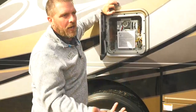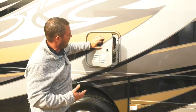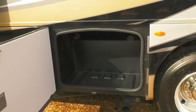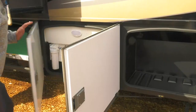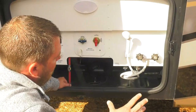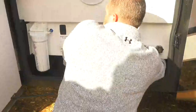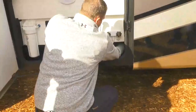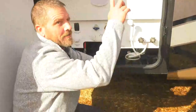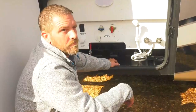More storage here with the inverter and a place for your bunk ladder. There's a fresh water pump accessible from outside — most RVs put this up inside a closet. Having it outside means if it fails you can replace it without flooding the coach, and it's still in a heated compartment.